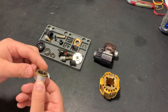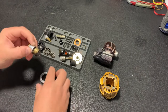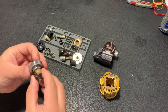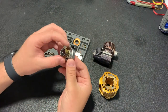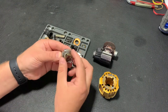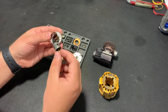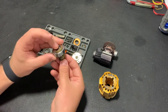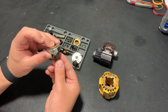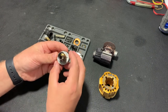But what I want to mention, don't try to do that with your working engine. It really could destroy it. Now the sleeve is inside the tool. I used a bit of foil. I don't know yet, will it work? What I'm doing next? I'm moving the piston inside to the top dead center that is near here. And now I will need to compress this ring.